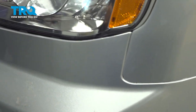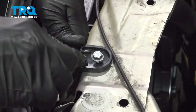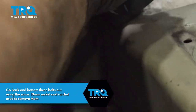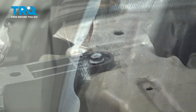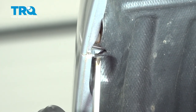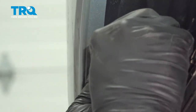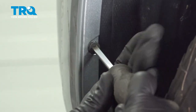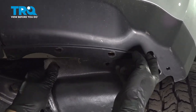Repeat this process for the passenger side. You're going to install your bolts on the top here — there are 10-millimeter bolts, we just happened to source a couple new ones. I'm not going to tighten them down just yet — we want to get these lined up and get those threaded down. Go ahead and install our upper screw and snug that in, then install our lower screw right here. Once we have that snug, repeat for the other side and go ahead and tuck your fender liner underneath the bumper.